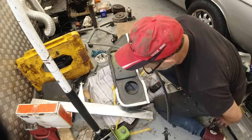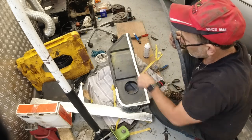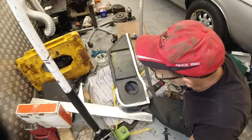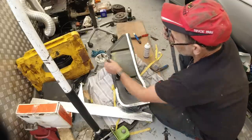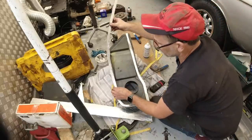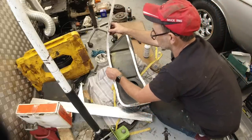I've gone over it with thinners, just gun thinners and a brush to get the crud off it, because it's gentle with a brush, you can't really do anything else. Then air gunned it down with the compressed air, so that these spaces here that I'm about to attach the self-adhesive foam strip to are grime free, and this will adhere much better. It's got little guide channels for this to go in.